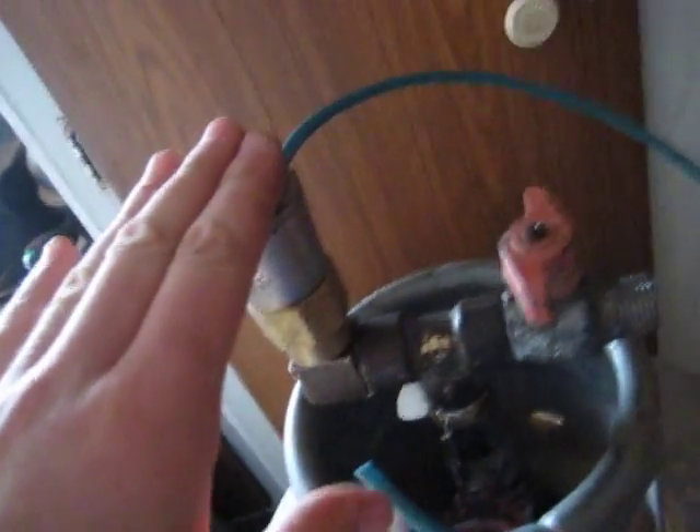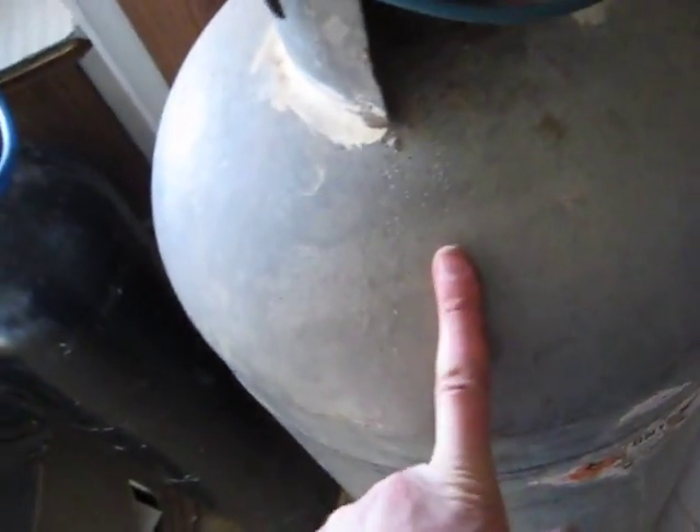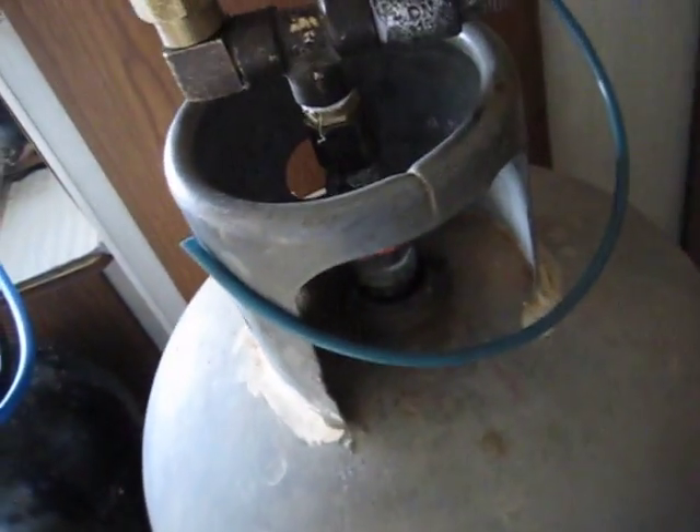Pump side - the side we use. Like, you'd screw a little connector on there with one of these T-fitting connectors. It remains shut off - shut the whole thing - it will be shut off by this tap here. Only problem is condensate in the tank. If I unscrew that, tip it upside down and flush water out that way - that would be the best way to do it.